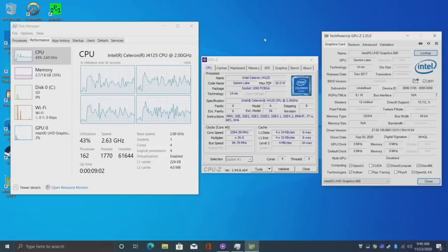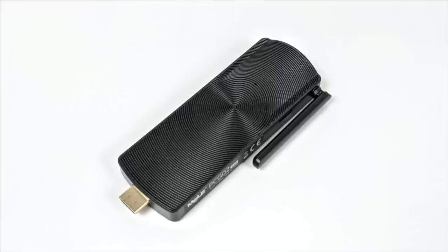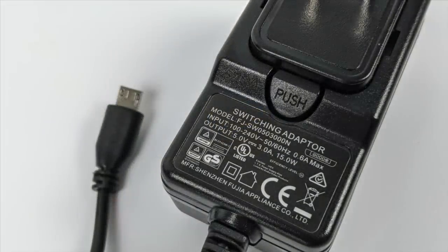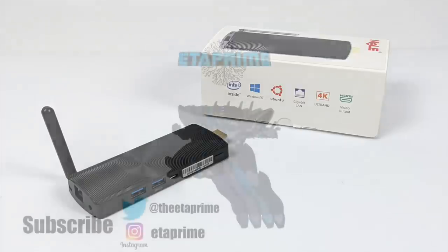Unfortunately, it's really hard for me to recommend this given that other devices on the market come in a little cheaper or at the same price and perform much better with the same exact CPU. I was hoping I'd at least get the same performance as the original LarkBox with more RAM, but that's definitely not the case — it really comes down to the power limitation set on this CPU. Even upping the boost time and wattage inside the BIOS doesn't help much. I understand this is a fanless setup and they want to keep power down to keep it cool, but this isn't even performing on par with the J4105. That's going to wrap it up — if there's any version of Linux you want to see on this, or if you have questions, let me know in the comments below. Thanks for watching.